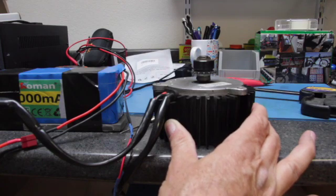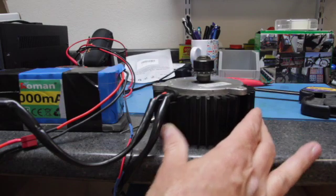Basically it looks like when the user sold me the scooter, the batteries were at such a degraded state that the controller couldn't get enough amperage and it would cut out. So it looks like we fixed the problem — I'm just going to run a stronger battery pack on this scooter and it looks like we'll be fine.